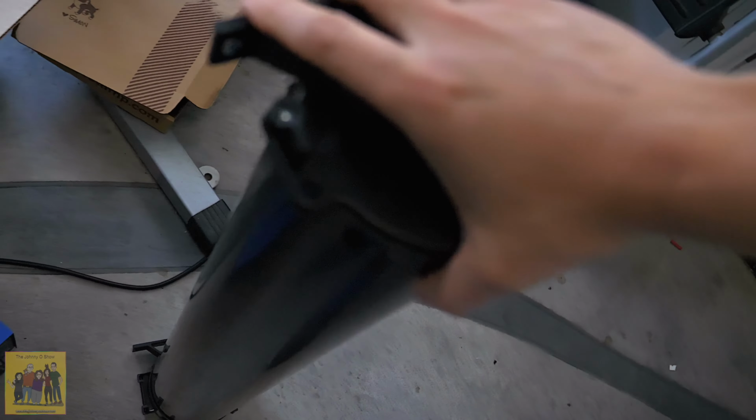So this is the 38 to 60 length. I actually only needed 58 inches, so I thought this would be okay. I am going to use it because I'd already ordered it, but if you need 58 inches, don't get one of these that goes to 60, because they only literally give you 2 inches of overlap in the middle, and I think it's going to be a little weak, so I'm going to have to do something about that. So then I ordered two more, but these are 48 to 80 inches, so that'll give me plenty of overlap. So we'll get these all out of the box and we're gonna get them fastened to the bottom of the camper. I went ahead and got new screws to replace the ones they had for the one that was already up, and I'm gonna put the 60 inch there first.